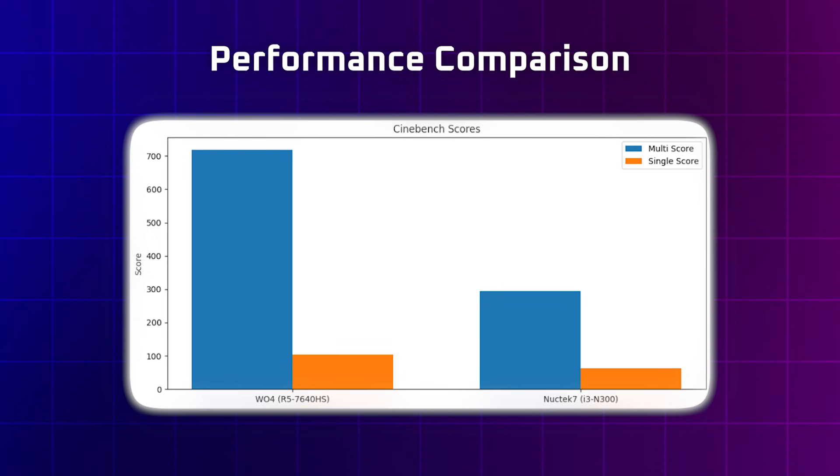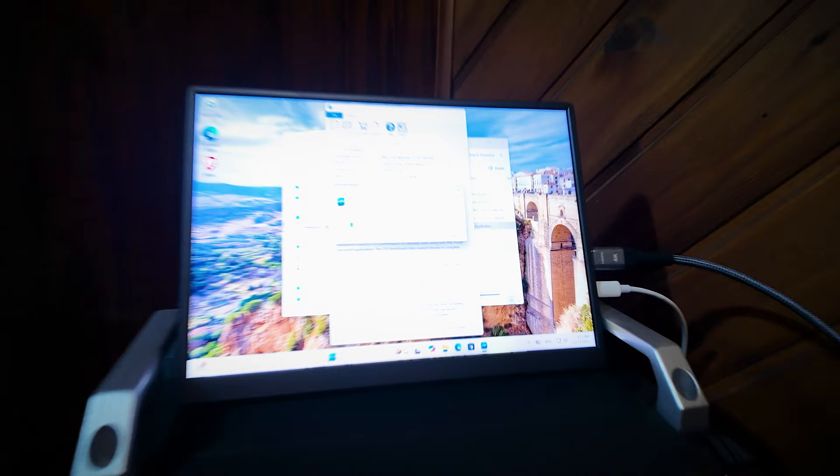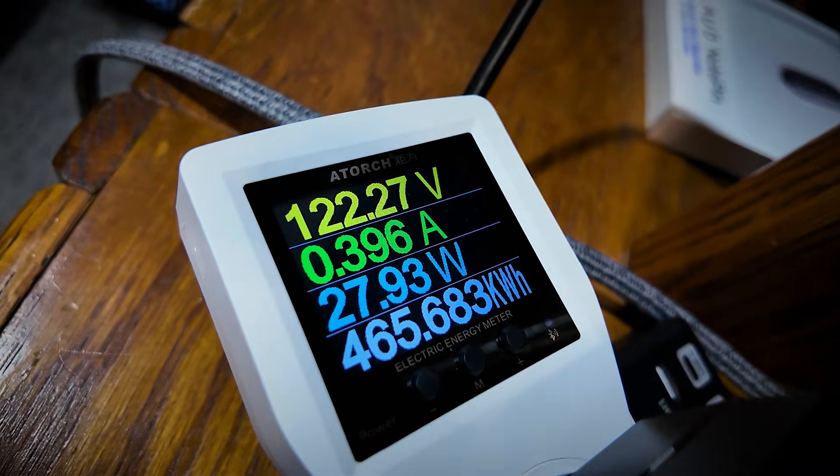I've recently started benchmarking all of these machines, and ran this one up against the latest other mini PC I reviewed, which had a 6-core Ryzen 5 and 32 gigs of DDR5. You'll see on the charts on screen, but surprise — the Ryzen is clearly stronger overall, which is exactly what you'd expect from a higher-power CPU. But where the Nook Tech 7 really wins is efficiency: during Cinebench and Geekbench runs it pulled around 46 watts at the wall versus over 70 watts on the Ryzen mini PC, so the balance here makes this box ideal for a virtualized network device instead of a general-purpose workstation.